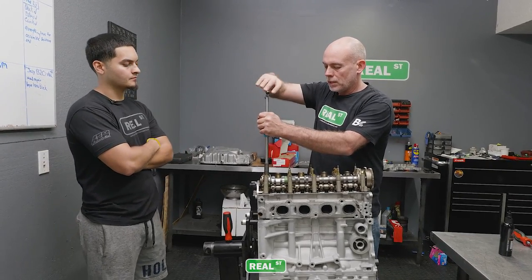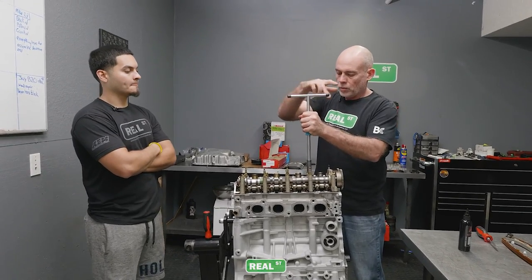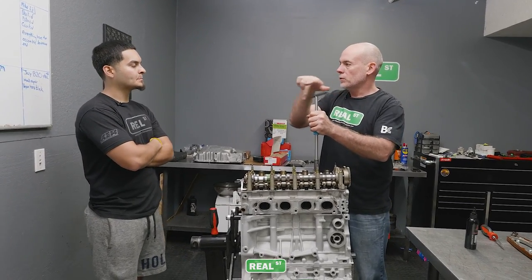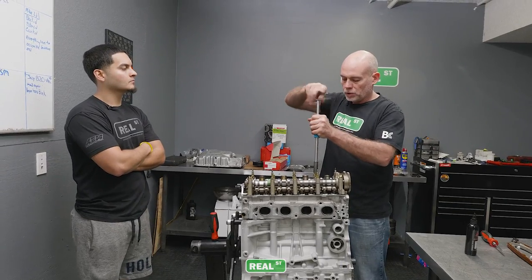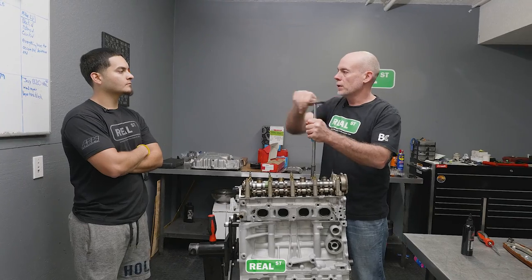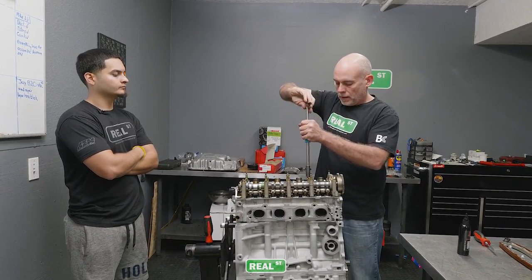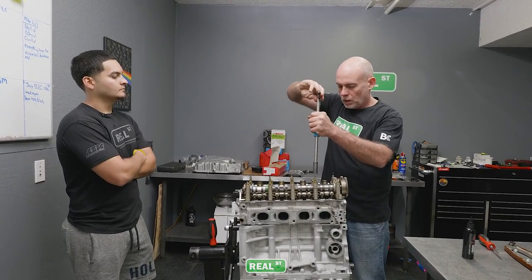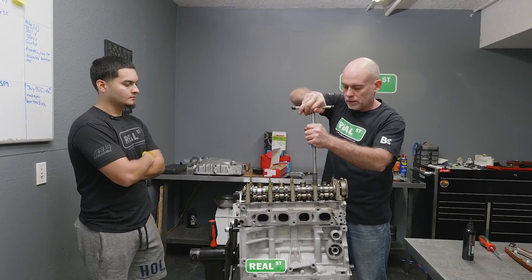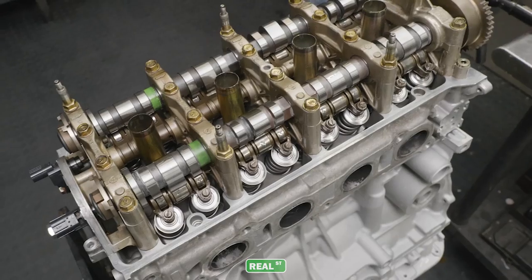Now you guys, unless you have the VTEC deleted, you don't really have to deal with that. Because you get the best of both worlds, you're gonna drive around on the small lobe, it's gonna have good low speed pumping character. And then whenever you go to high engine speed, you go to the high speed lobe and you have lift and duration that works well with this incredible cylinder head to make a ton of power.